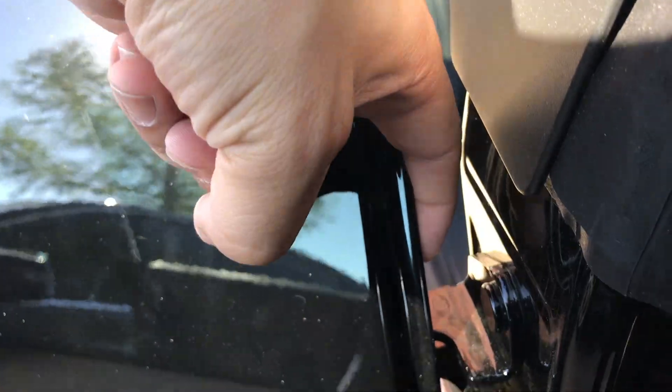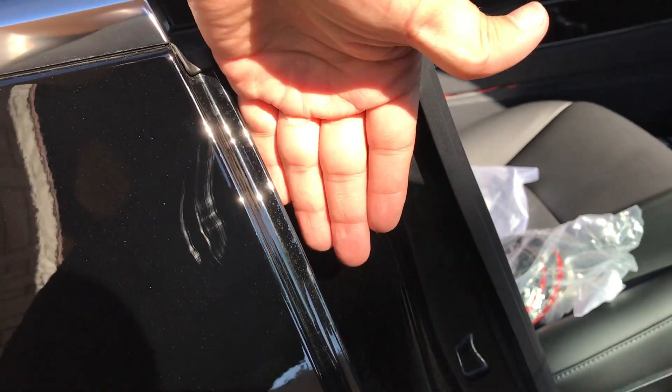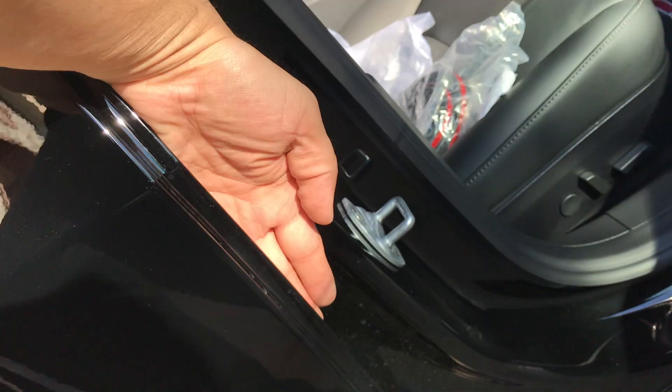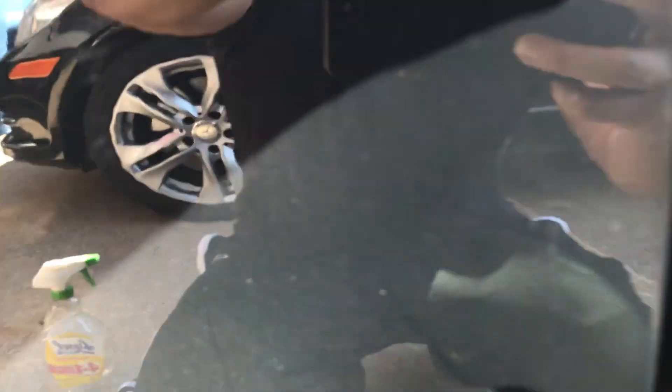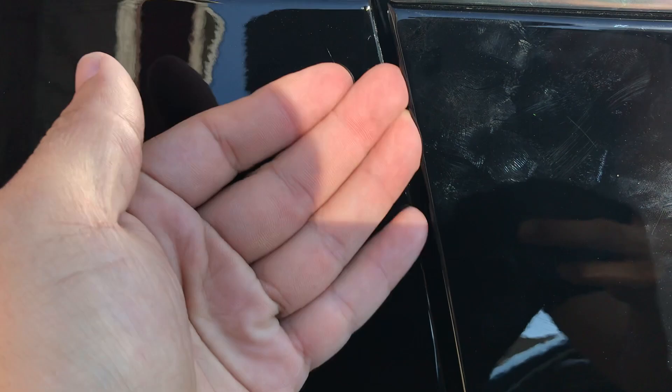All along — see it right here, behind it, not in front, behind it. So when you close the door, the bottom portion of the S-shape is gonna be kind of sticking out like that all the way to the bottom. The S-shape is gonna be blocking it — you won't see it, it's not gonna be visible from the outside. It'll be inside blocking any type of debris, any type of water that comes in through here, and it'll make your door quieter when you close it.